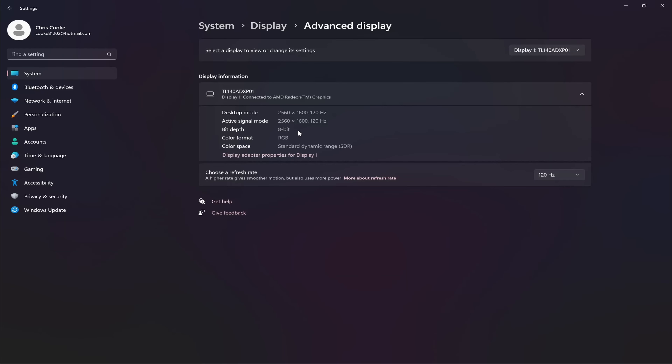Next, go down to Switchable Dynamic Graphics — this one is important. Go to Global Settings, On Battery, and set it to Force Power Saving Graphics. As soon as you unplug the AC adapter, this will completely disable the discrete GPU, switch to integrated graphics, and immediately save you power. You won't have to worry about the GPU randomly turning back on, so I'd definitely do that.